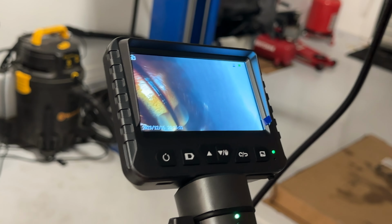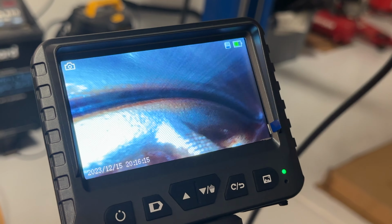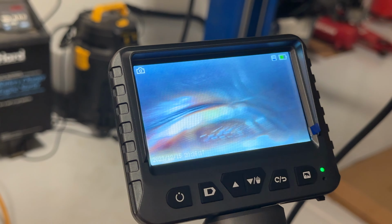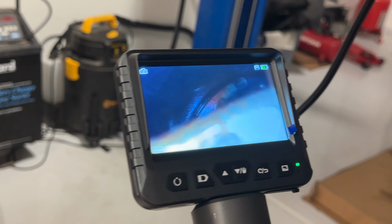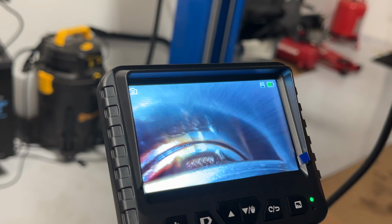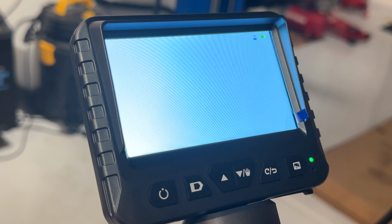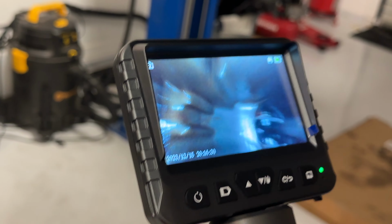You go through all your normal things as you would, kind of backtracking. And I didn't touch anything in the bottom end. I already inspected everything in the bottom end. This was me going back through a second time. And I already put oil into the cylinder to see if it was a piston ring issue like you would have expected, but not that.